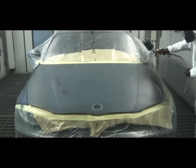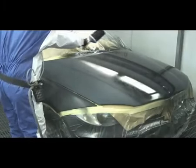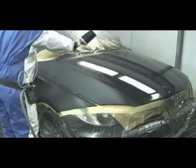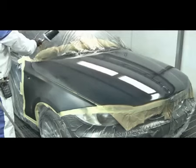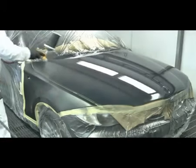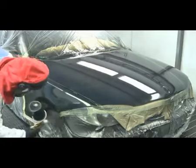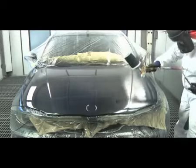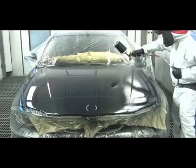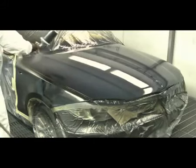Aquabase Plus can be applied in single coats or in a one-visit application process. The benefits of the one-visit application process, as being demonstrated in this repair, are: material savings as you only apply to a dry surface once and the second coat is over a wet paint film; time savings as you do not have to wait for individual coats to flash off — only the once; energy and utility savings as you only have to flash off the base coat once; reduced booth process time leading to quicker throughput, energy savings on booth running time, and a possible extra vehicle through the booth in a day.